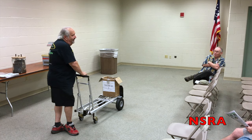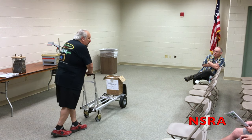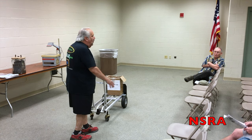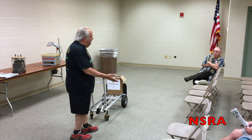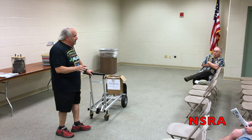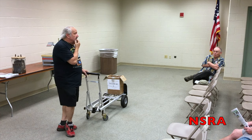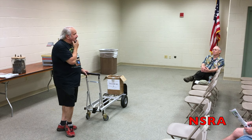I get guys that buy my jump starters and they do that. If you're fortunate and you don't have anything turned on and the voltage of the 6-volt battery is low enough, when you put a 12-volt onto a 6-volt, like a jump box, it will come out to around 8 volts, with the 6 volts down to 4 or something like that. That sounds reasonable, right? So you try to start it, it starts. As soon as you start it, however, and your generator starts putting in some excess, you'll spike up to 12 volts. And if you've got anything on that's running on 6 that all of a sudden spiked up to 12, you're going to burn it up.